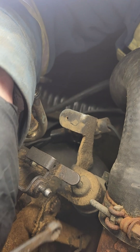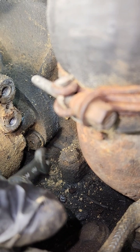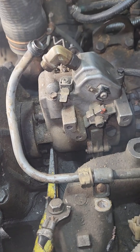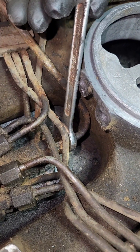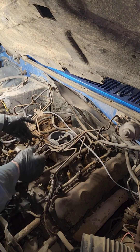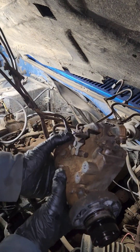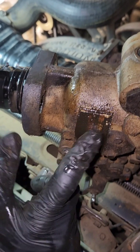I can't remember what I was doing with that 390 when I had the wires off it. I must have been giving her a tune-up. I had all the ignition wires off it, and when I put them back together the thing backfired through the carb. A big fireball came out, lit the grass on fire, and gave my roommate a heart attack — sounded like a bomb went off. Then I realized I had wired it up for a Chevy and not a Ford. The cylinder identification is different: Chevys run their cylinders 1, 3, 5, 7 on one side and 2, 4, 6, 8 on the other, whereas Fords run 1, 2, 3, 4 on one side and 5, 6, 7, 8 on the other. That's a big factor to look at when you throw your ignition wires back on.